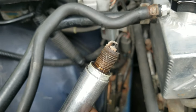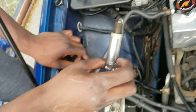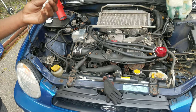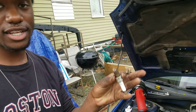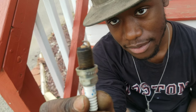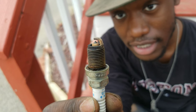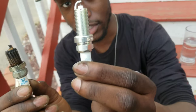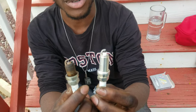The passenger side ones being more white means you need new spark plugs and probably a tune. Time to put the new ones in. You can see the difference between what a bad spark plug looks like and a good one — the old one isn't terrible, the gap doesn't look like it's changed too much and there's not really any corrosion, but compared to the literal brand new one, the difference is clear.